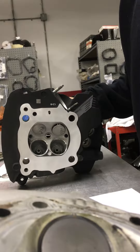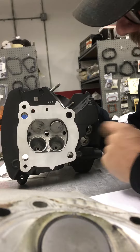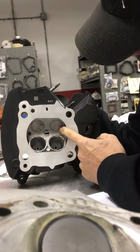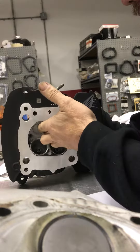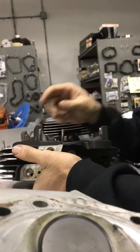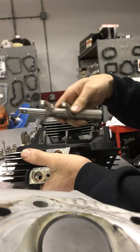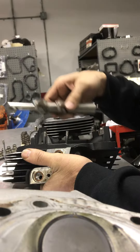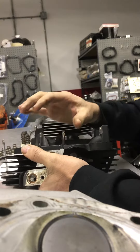Continuing progress with the M8 head, figuring a few things out. All valves are marked — front exhaust primary, front exhaust cam — keeping everything exact in the holes they go in. With this common rocker arm, it has one shaft that hits both valves at the exact same time, so when we do the valve job and seat cutting, the stem protrusion has to be exact.